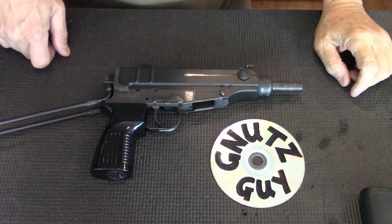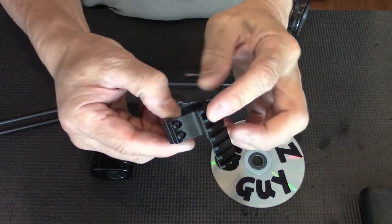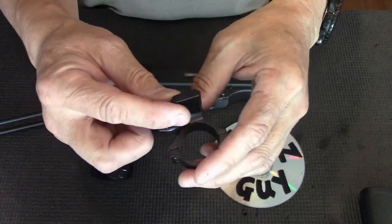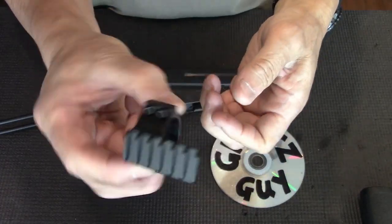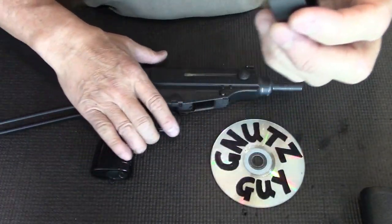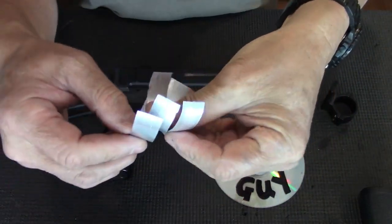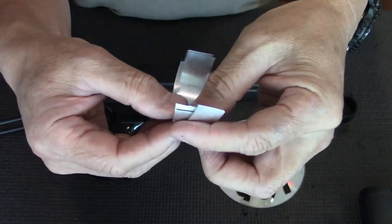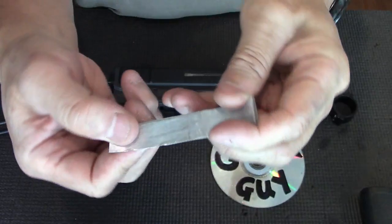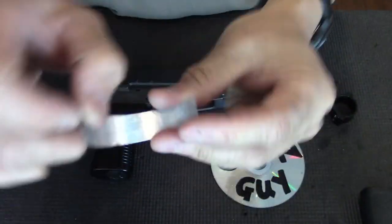Okay, to solve the first issue of the front end, you need to buy yourself one of these barrel clamps, 30 millimeters, and you have seen them before. They're on eBay for about $3 US. Not very expensive. However, 30 millimeters is a bit too big, so you have to cut these thin strips from a beer can or pop can and rough the surface out using a wire brush on a drill. If it's too smooth, it's going to start to rotate.